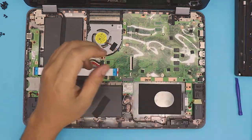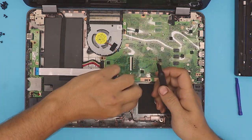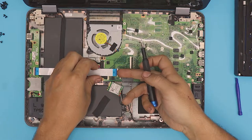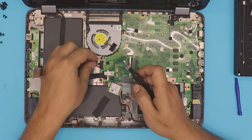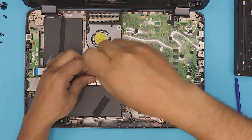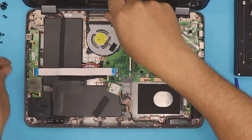You're going to take the hard drive out and take the Wi-Fi module out at a 45-degree angle. You can go ahead and disconnect the battery, but I don't see it as necessary. You're going to lift up this connector — I'm not going to remove it, I just want to get to the other side. If I remove the battery the BIOS is going to reset, and I don't want that.